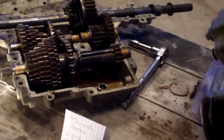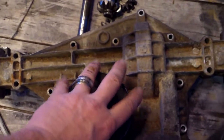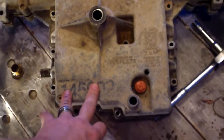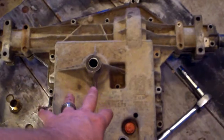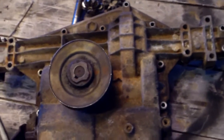If you're going to do that, just change the whole transmission case and everything. But parts from this model — whether it is a four-speed, a five-speed, or a six-speed — will all interchange, as long as they share the same mold pattern. All of the gears from this model, four-speed, five-speed, or six-speed, will interchange. Take the chunk out of this model's four-speed and put it in this model, and you've got a four-speed.